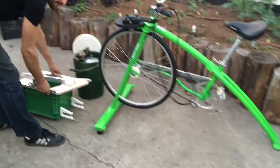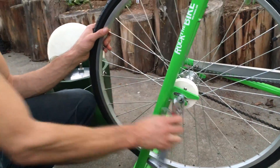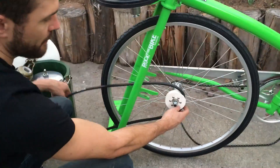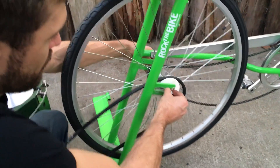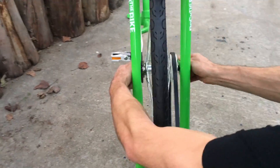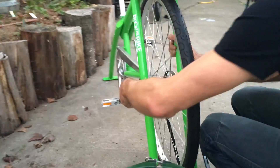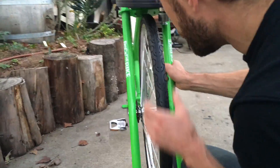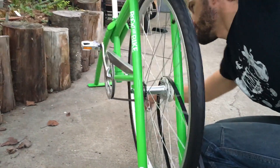We'll start by loosening the wheel. You may have to replace your wheel with one that comes with this disc brake module — just a brake pulley. Slip that around the pulley, then slip it in the dropouts so the chain is fairly taut. I'm looking down the center line of the frame to get the wheel centered relative to the top tube. I'm going to make these finger tight, then spin the cranks once to make sure the chain is not binding.